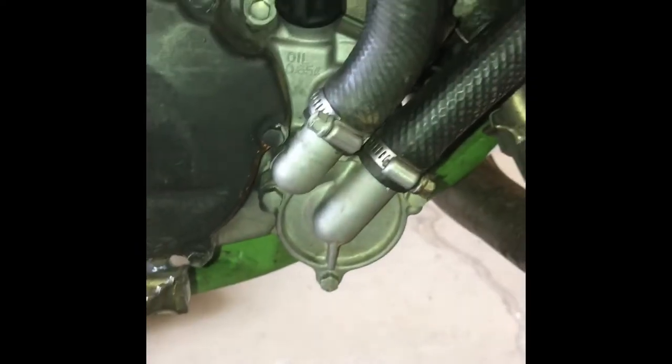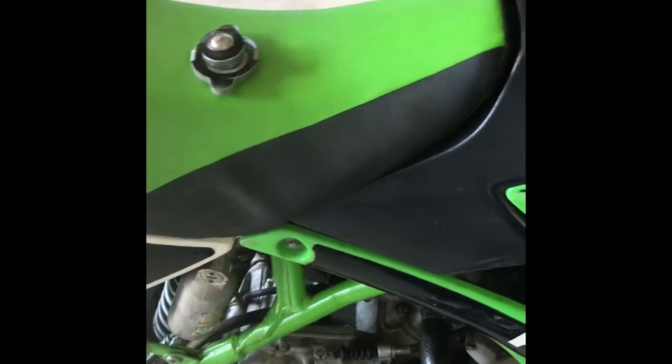This is what the oil looks like in the crankcase. There's a leak in our seals here, so that's what we're going to be replacing today. Because we'll be draining both the radiator and the crankcase, I'll be taking this plug off and I already have the radiator cap off. When we open the drain plug, we have airflow through the whole thing — we're not creating any suction.